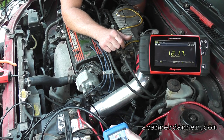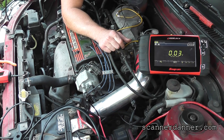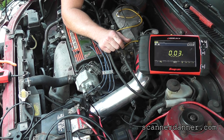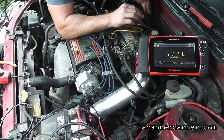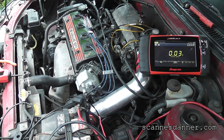We don't really need to do this part, the control circuit, because the amperage we had said the control circuit was good. We had over 10 amps of current. Let me see if I can find that wire and get a reading off of it. Oh, there you go. Okay. Turn that switch off. Turn that switch on. Yeah, those aren't numbers we wanted to see, man. Those are good numbers, but the reason I'm saying we don't want to see those numbers is your starter is bad. Yeah.